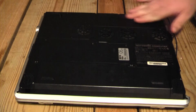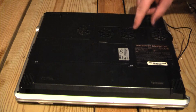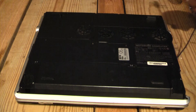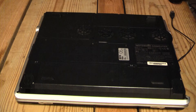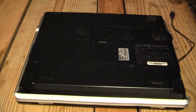There are four fans on this machine. These two are for the processor, and this is the system fan. The header for this fan has died on the motherboard, so what I did was rewire it to a USB connection, and now I just have to plug it into the back or side where a USB port is, and the system fan will run and keep the system from overheating. This last fan is for the video card, and it all shoots out the back. It's fine — the video card is not beneath the wrist when gaming like on the old Alienware. I think this is a better design, but I have had four broken video cards in this, so maybe something went wrong.